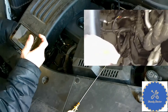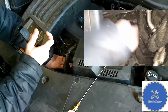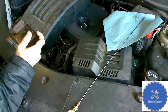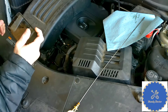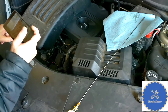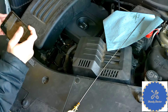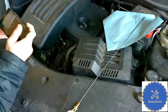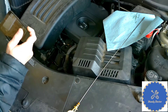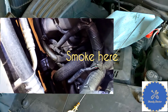So now the engine is off. And let's try to do the same — put the piece of paper on it. It drops off. It doesn't stick. So if your paper can stick on the dipstick hole when the engine is running, that tells you it's a good sign that your PCV system is in fact working. So that's the second test. I will show you a video I took from a while ago. When it goes so bad that not only is there no vacuum, some smoke is coming up from the dipstick hole. And I will put the video within this main video and you will see the difference.